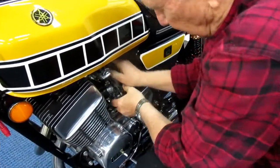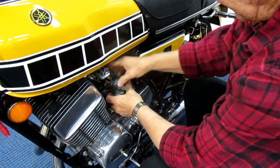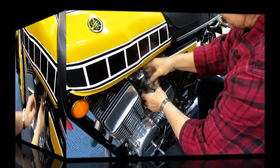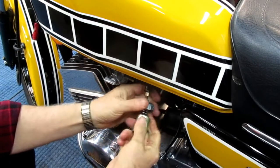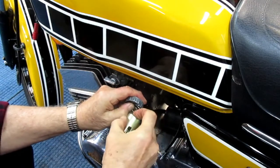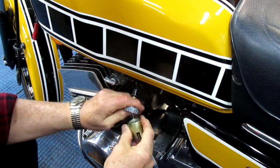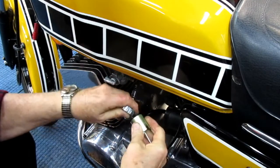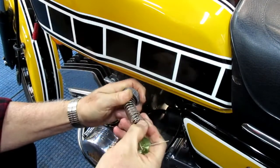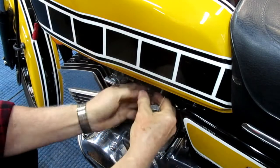All right, so that's going to come out. And we take the top off, and we'll have the carburetor out in our bare hands. Anybody that's got a two-stroke knows how to do this, because if you're going to jet any two-stroke, you're going to be jetting it from time to time, and in this case, this will come right out. There's our slide. Don't let the spring jump out. Oops, this comes right off, and this piece will be replaced.